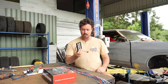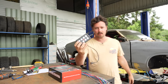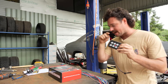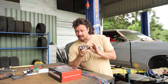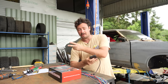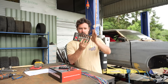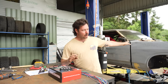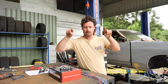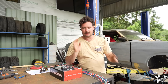For anything that's low voltage - since the pumps and fans are all going to relays as higher current drawing things - we use a lot of power. For all the LED lights that are very low powered, I got one of these electronic wiring system switch panels. It's a solid state switching panel - a really awesome bit of kit. It's little button switches that go through a box that already has internal solid state relays and fuses. It actually has 32 channels at 30 amps which will run a fan as well. So I've got this switch panel which will sit where the shifter is, and another one up on the roll cage.